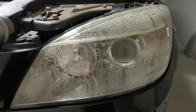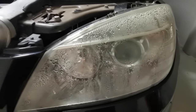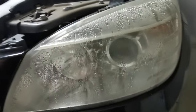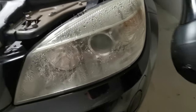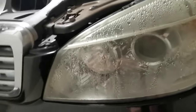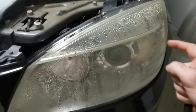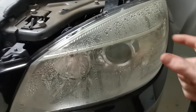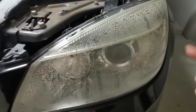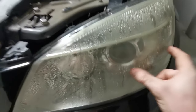There are other methods because not a lot of people will have shop air with enough tank capacity to clear it out easily. The other way is using a vacuum and a hairdryer. Most households will have both, and the same principle applies — take the cap off a suitable cap, you can take more than one off, allow the pipe to come in, and all you want to be doing is recirculating that air while heating up the actual lens to dry it out.